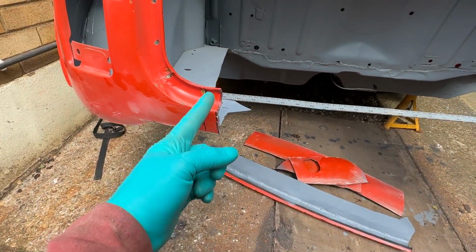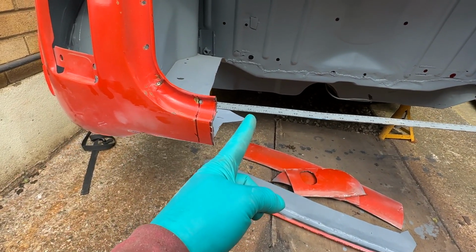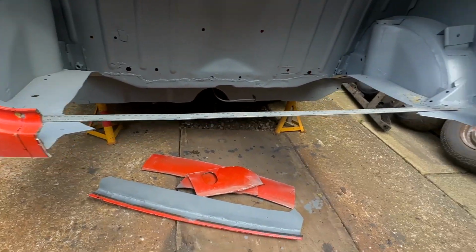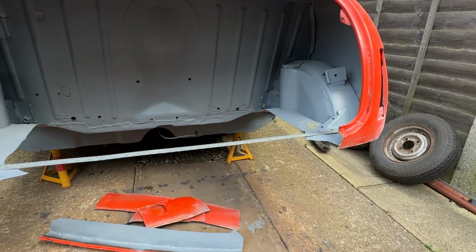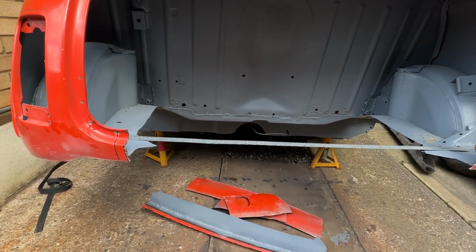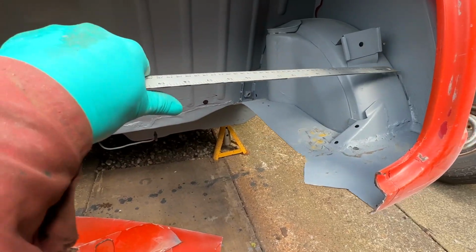As I was cutting through the very last piece, which was this very back bit here to change the blade, it actually got pinched as the metal came out of the way and there was still tension on it. So just be aware that as much as it's there, you cut a chunk of metal out and there's nothing holding the two sides together, those two sides can split, they can come together, there's all sorts of possibilities. Now, albeit risky, my reason for doing this is access.